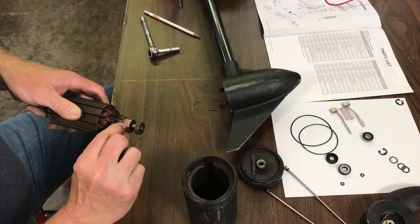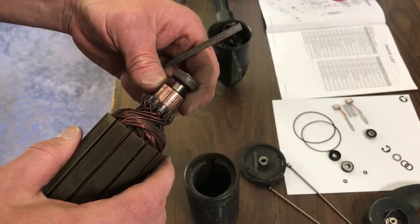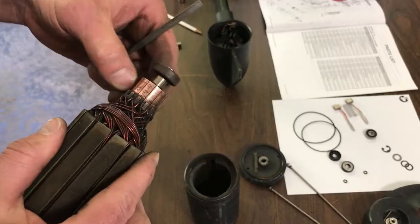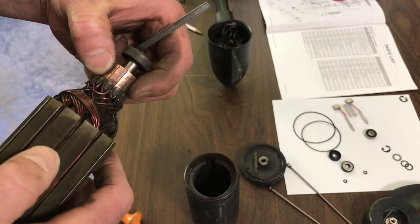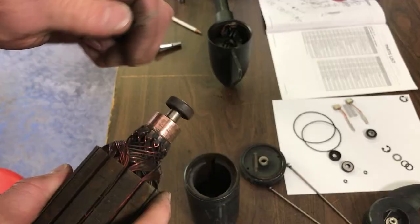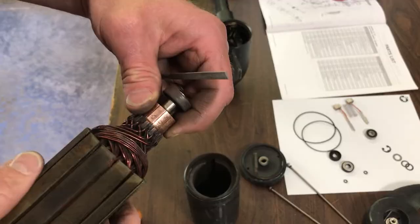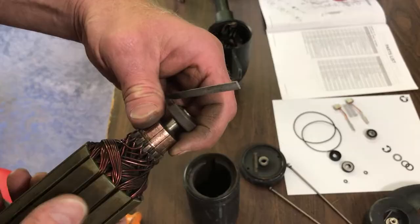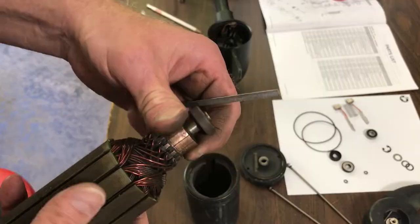Inspect it for bad spots — I have a bad spot right there with a catch in it, and one right there too. My armature had some bad spots where it arced when I tried to make it work, and it had some rough spots sticking up. I don't like filing on an armature at all, but they were so rough I had to. I used a small file with not much bite and just got the rough stuff down. I'll continue with this kit — it should work fine, but next time I'll probably need a new armature.